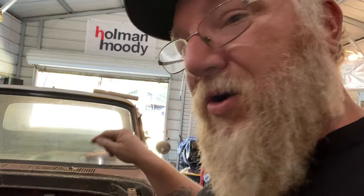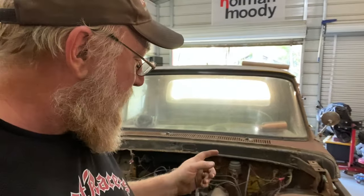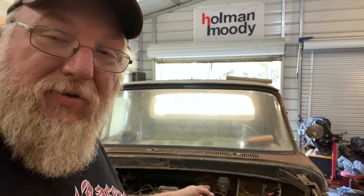It was already teed in there, unhooked the rear line, put a block off where the rear line goes in, and then I put a union and ran a new line from there up to the master cylinder for the rear brakes. I have been running that Galaxy for 5 years that way. It has never given me a single leak or a single problem.